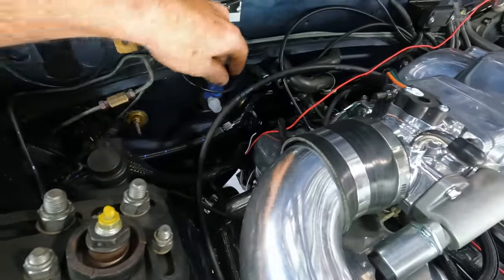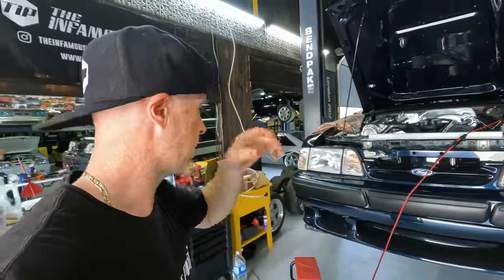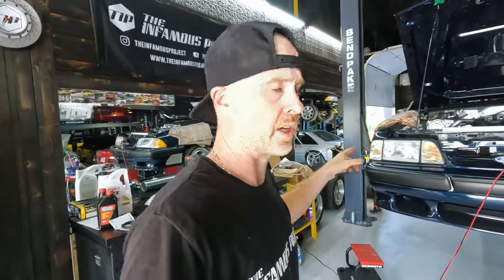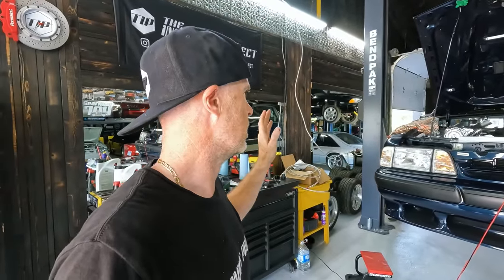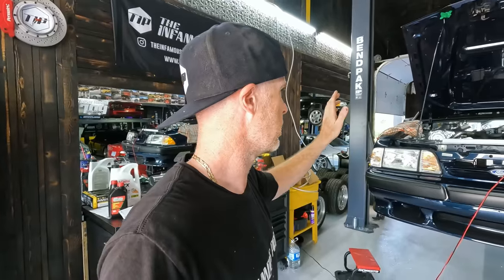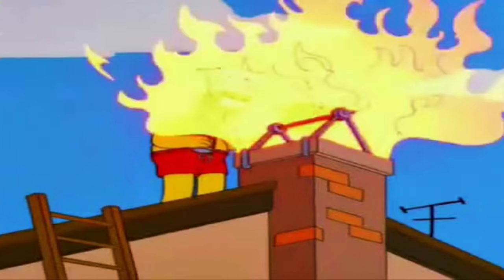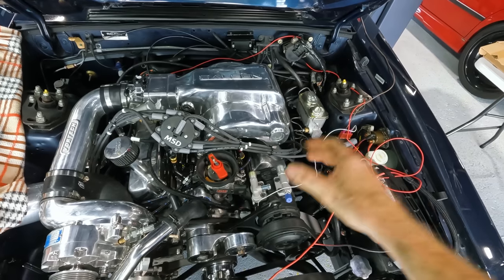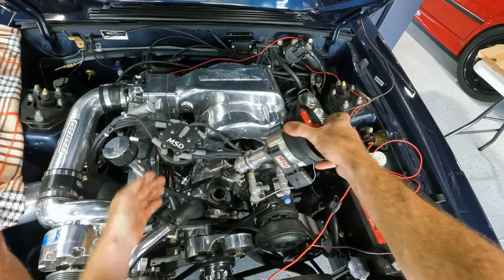I'm going to put the tank up, rather. So already got top dead center. I'm going to get the tank stuffed back up and tighten up that line. From there, we'll pull the dizzy out, prime the oil pump, and fire in the hole. Fire in the hole! All right. Pull out the dizzy.